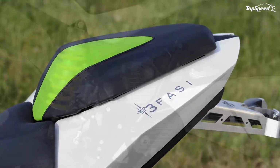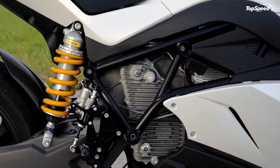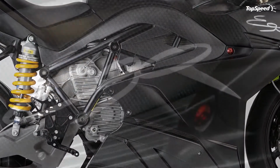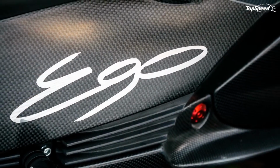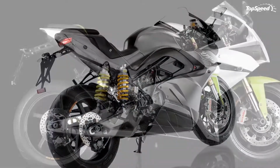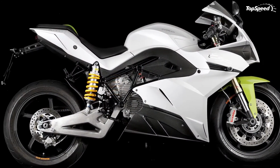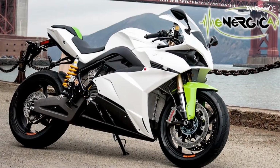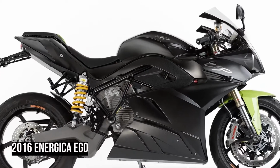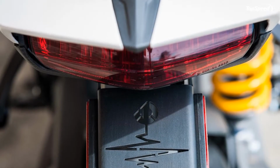Motor management falls to the Vehicle Control Unit (VCU) that comes programmed with 4 separate riding modes: Standard, Sport, Economy and Rain, and 4 regenerative maps for absolute control over power delivery and conservation. The battery rated for 1200 cycles can take a charge in 3.5 hours or less, as low as 30 minutes for an 85% charge depending on level of discharge and which of the 4 charging modes you use.